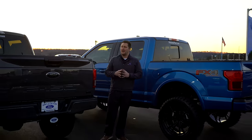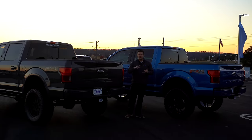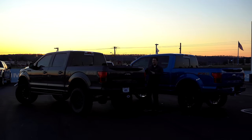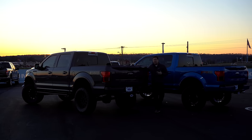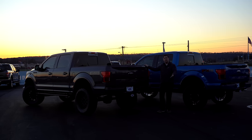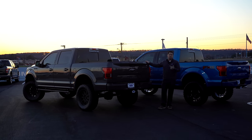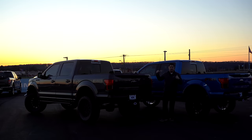I hope this video helped clear things up. The main thing is to assess what's right for you — what are you going to be doing with the truck? If you're going to lift it anyway and have the cash, go ahead and get the coilovers because they may ride a little better. But if you're short on cash, the coilovers are the first thing I'd skip. Go with the puck design and upgrade to coilovers later if you want.